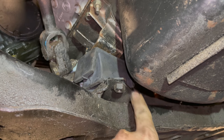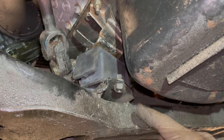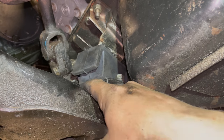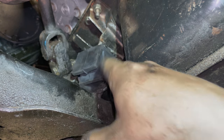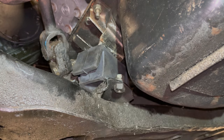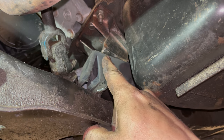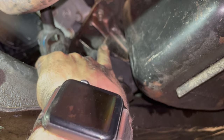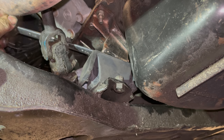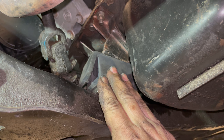I'm going to lower the engine a little bit so that I can get these bolts lined up first. I'll put one in right now — that's in there loosely to help guide everything into place. Now I'll just lower the engine a little, then move to the other side to get that other bolt started. I might have to use my pry bar to move the engine around to get everything lined up. I have both of these bolts back in and tight now. I just need to put the nut up there — I'll put the washer on first, and that was a lock nut, so I'm going to have to spin it the whole way on with a wrench. Everything's tight. I'll lower the engine down now. This motor mount's not bulging, it's not soft — should work a whole lot better than the one that was on there.